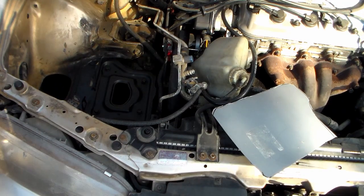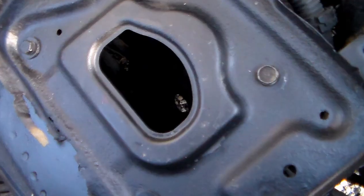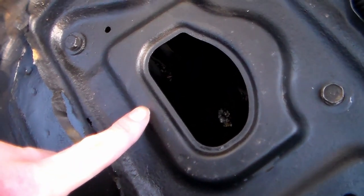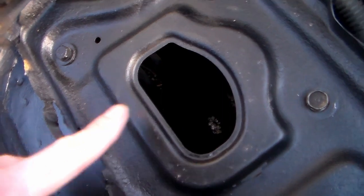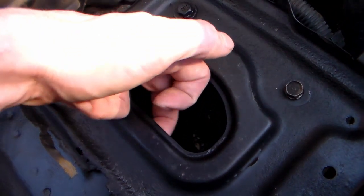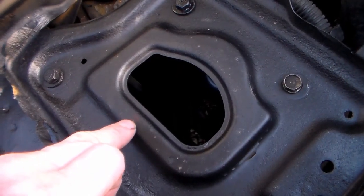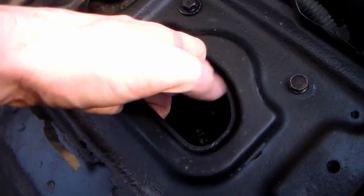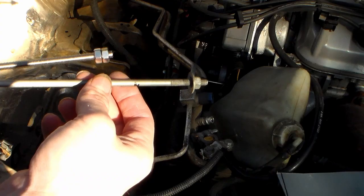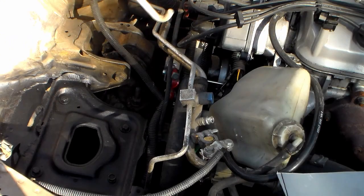I'll take all this back out — take the battery out and look back at where we marked. There's a Sharpie dot right here. The cool thing about this is that I can reach my hand under here and reach that spot, which means it could be drilled and we can put something there to hold one of those rods. I found exactly what we needed — the thread on this rod, the stock hooked rod, is an M6 thread.